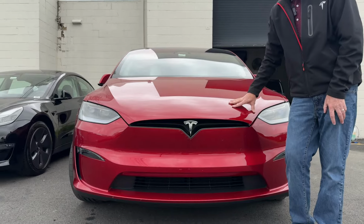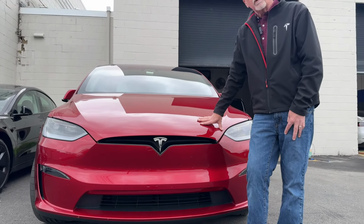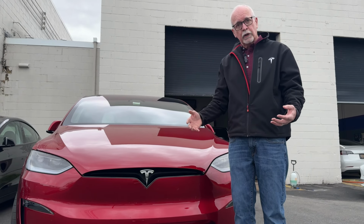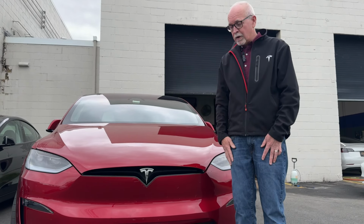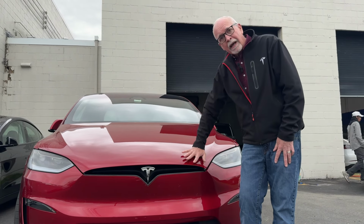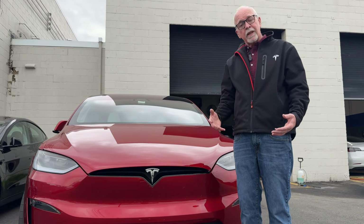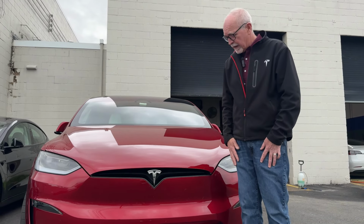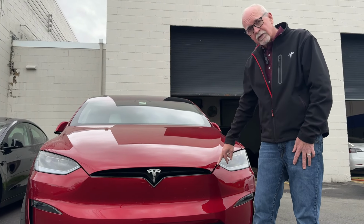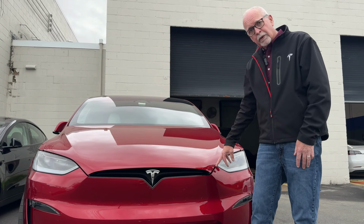That's typically what happens in shops, or if you try to do it yourself, you're just starting with the wrong panel. And ultimately, they adjust every single panel on the car, and the whole car looks worse than it was. So the trick to understanding good body fit and panel gap is, where are the fixed panels on the vehicle? You always have to start there and then make your decisions about how to straighten this out. So on this vehicle, we'll take this one apart and we'll make these corrections to get this front end to fit. Maybe we'll show that in another YouTube clip if you want to see how it works.